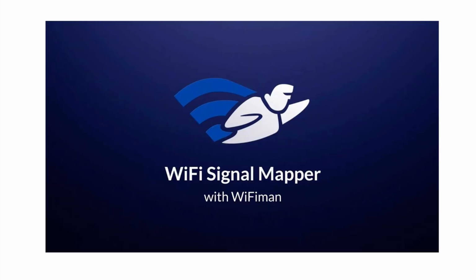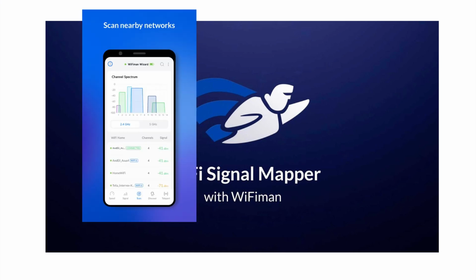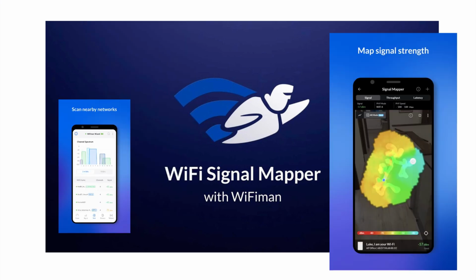We also recommend using some sort of signal mapper, an app on a phone, something like that, just to map where the Wi-Fi is, because a lot of people misunderstand Wi-Fi, so they will plug in the Wi-Fi extender nearest to the device that they want to use rather than where it's picking up the strongest signal. Same again, we use a product from Ubiquiti, which is wonderful and free, called WiFiman. That can actually use augmented reality, and you can do a plan and see where the Wi-Fi signal is strong, where you could put your extender in.